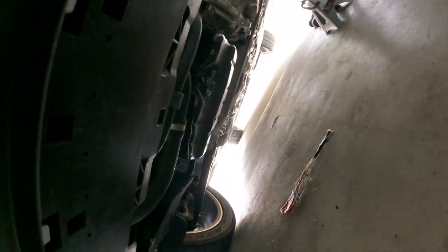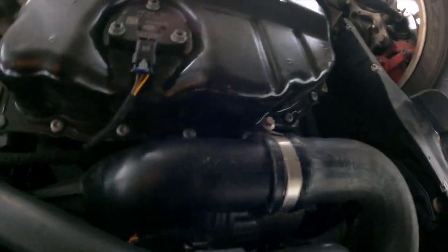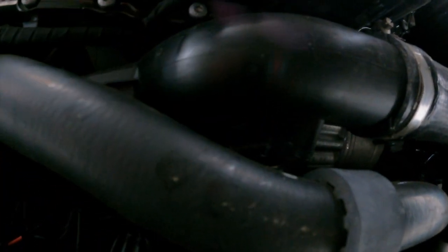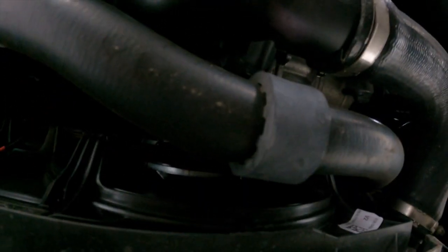Under tray's off. You're going for this sensor right here on this pipe — looking down at your oil pan. This right here you're going to unplug, and then we'll drop the harness down and connect into that. That is your PUT sensor — pressure upstream throttle sensor.